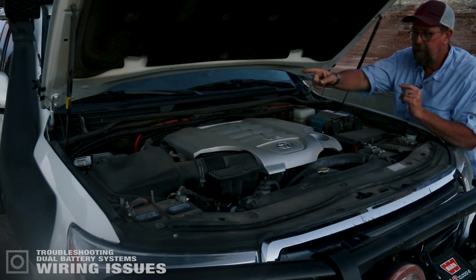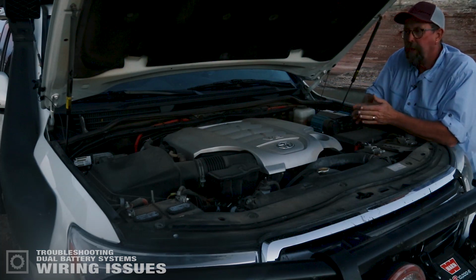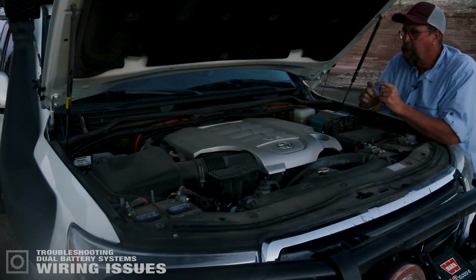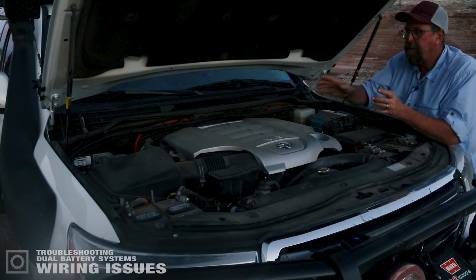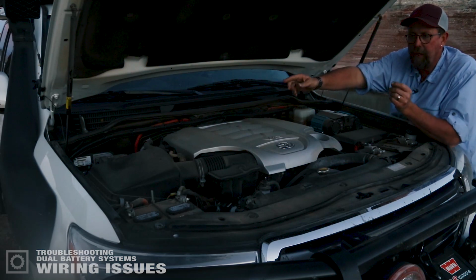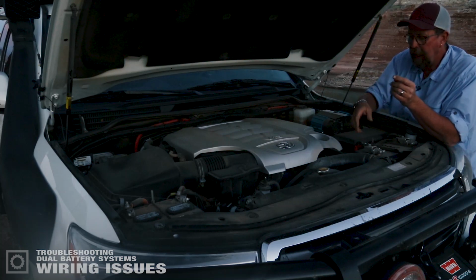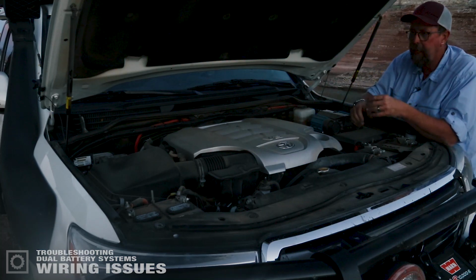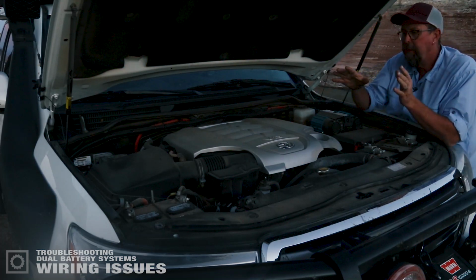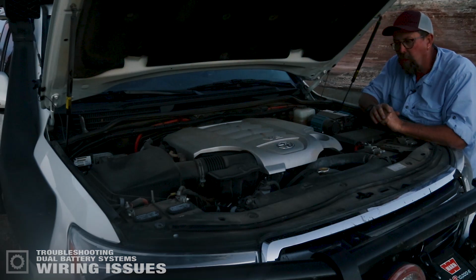If you're still getting a different voltage between these two, it's obviously a disconnect in the wire system. One thing you want to make very certain you do not do is put anything in that loop other than the wire that's in place. There are no extra switches in place, no extra cutoffs, any of those things, because the intelligent solenoid has sensitive material in there that it's trying to read the exact voltages for isolation and connection, and that can be thrown off, whether you're using a body ground, which is not a good idea, or you're putting in a switch, or you're connecting wires in for other pieces of equipment on your engine. It's not a good idea. That needs to be a solid loop, independent of any other electrical control, to make that happen.